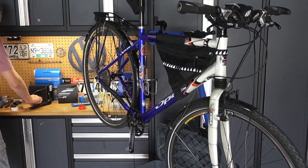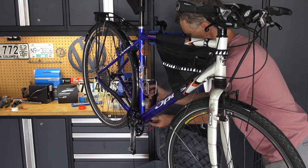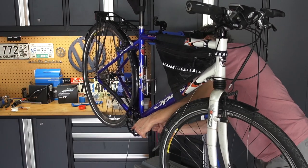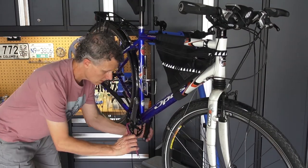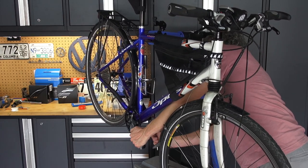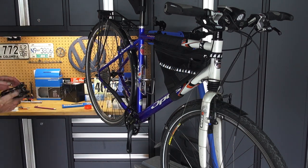Then put the new cranks on there. This crank didn't come with the chain ring — that chain ring is a 42-tooth narrow-wide chain ring, which helps with chain retention when you don't have a front derailleur or any kind of chain guide. It's a semi-compact road crank, so you've got to get a chain ring that matches the bolt circle diameter. I did have a 42-tooth chain ring on my old cranks, but I didn't use it because it had been on there for years, the cranks were getting a bit creaky, and the narrow-wide chain ring will help keep the chain from coming off.